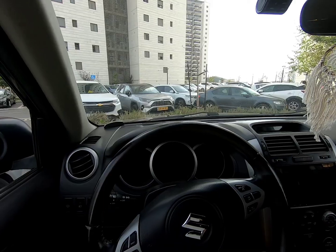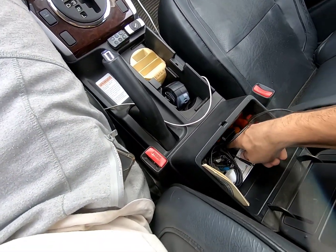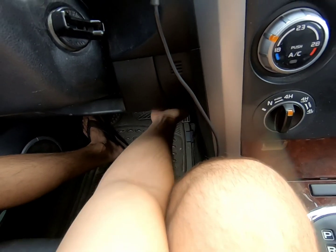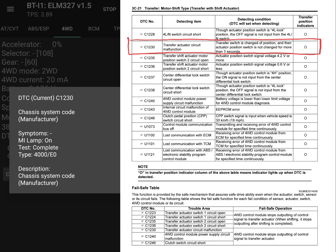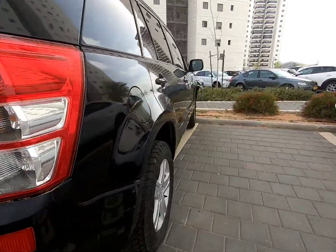Let's dive into this issue. First, I take my OBD dongle — which you can buy on AliExpress with the link in the description — connect it to the OBD port, and open the SD viewer up. And what do I find? Looks like a transfer case actuator motor problem; it's probably rusty or corroded. There is another problem in the ESP module, but I think it's related to the actuator I just mentioned.